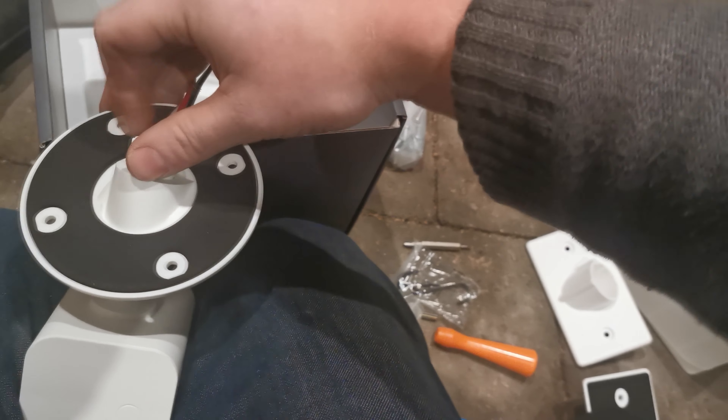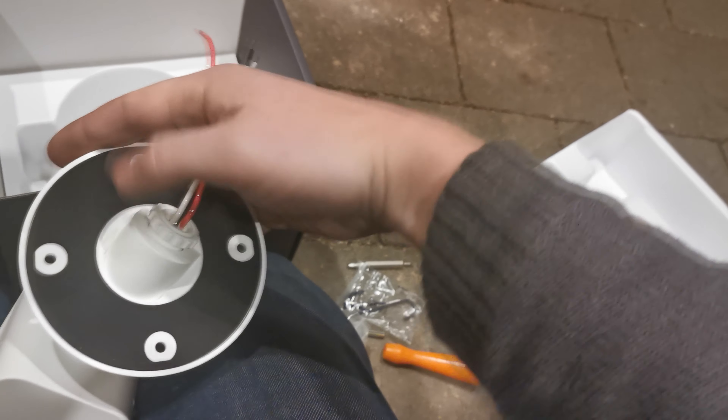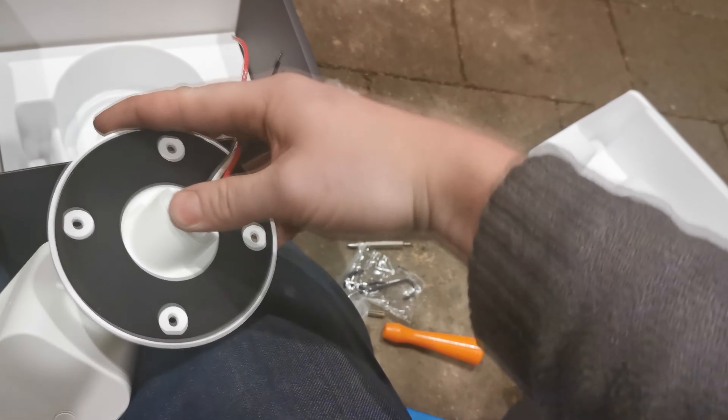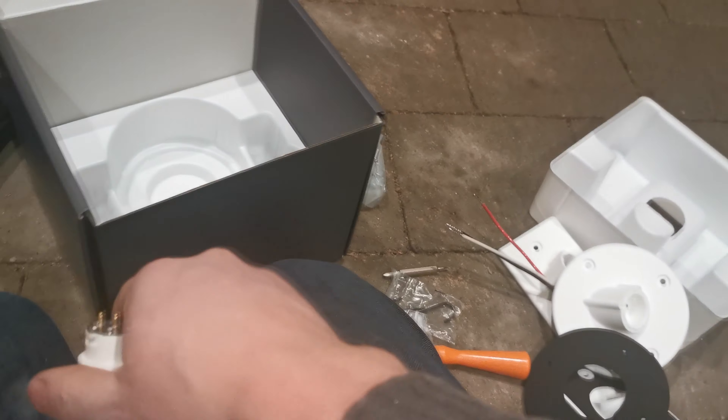Take your threaded ring and bring it down. Don't strip it, just get it in there because it is plastic. Once you tighten it down, you now know how it's going to position. I know that when I bolt this plate flat against the roof I just have to loosen that set screw, and then I'll be able to adjust that knob and adjust the camera where I need it. Once you do this, twist it again — quick disconnect — and we now have that ready to go.